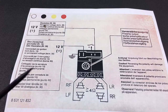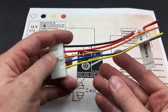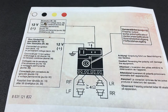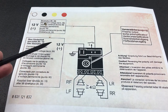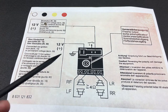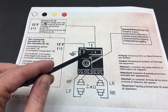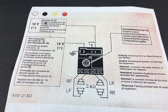Basically this is a four-channel unit. There's a proprietary connector at the back — in fact the harness of the car looked something like this, and these are still available online to buy as a replacement. There are two slightly wider pins on the left and a couple of narrow pins on the right, but this radio only uses a few of those. The first pin is ground; the next is 12 volt from ignition — the main operating power. Then there's a 12-volt pass-through that sends a signal out when the radio is on, useful for powering a power antenna. Lastly, there's a permanent 12 volt from the battery, specifically to keep the radio memories stored.